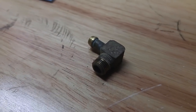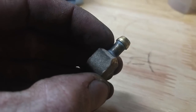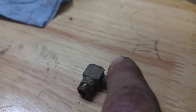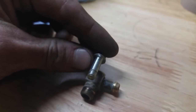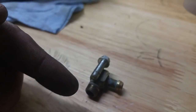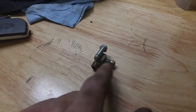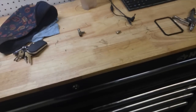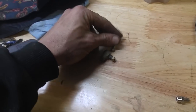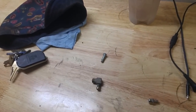This is the thing we're going to modify here. Turbo's on this side, boost goes through here to the wastegate. If you drill a small hole on one side and then put a bolt in it and cut off flow, then if the flow is less than the hole, there's going to be zero pressure at the wastegate. So you can dial it in and allow just a small amount of bleeding off, and then the wastegate opens wherever you want. There are better ways to do it with a spring and a check ball, but this just works for anybody because this is already in the truck — you can just pull it out and build it.